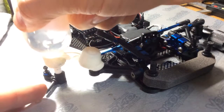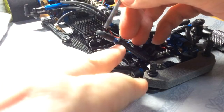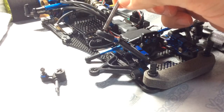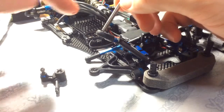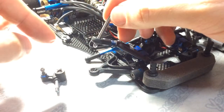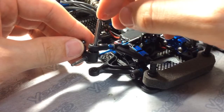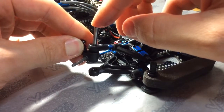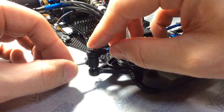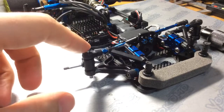Before you put it through the three points of contact, just put a little dab on there and on there, and maybe put it on the top of the block here. The reason I'm doing that is once the pin slides through, if I did this when it was dry, the tolerances are so tight it would probably shear off the lubricant from the shaft. So I'm pushing through the ball while still maintaining the lubricant on the shaft. Then do the same with the steering block and follow through to the lower block. Clean off whatever excess on the top or the bottom.